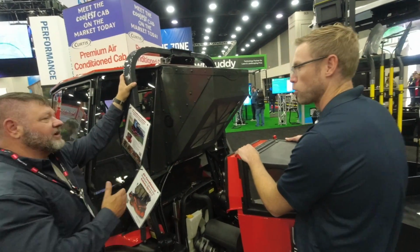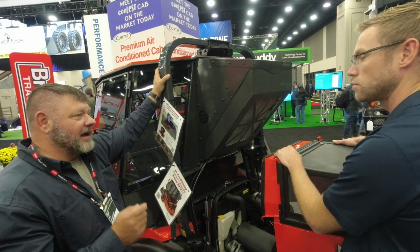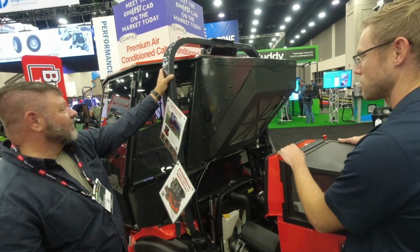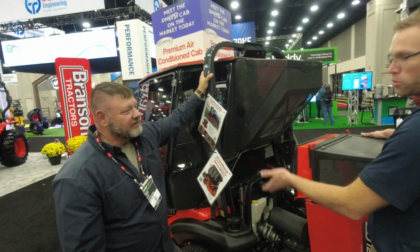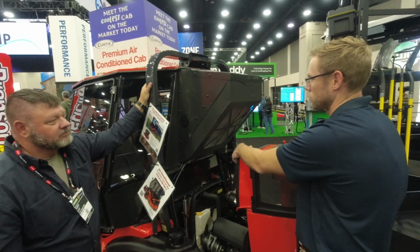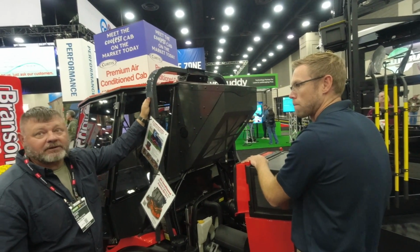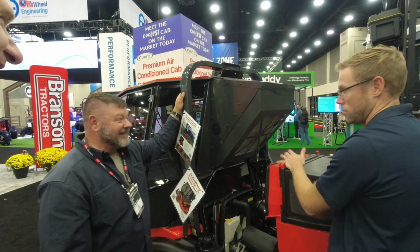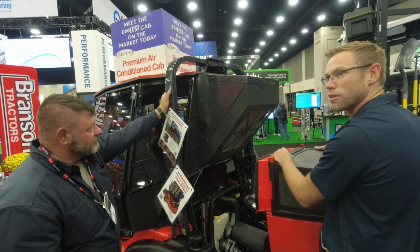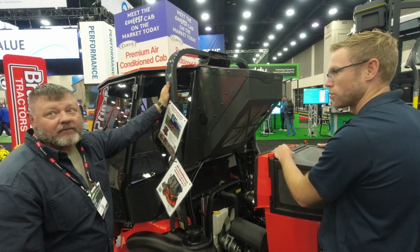So we decided everything's appropriate. Tennessee. It's 100 degrees outside and humidity is 9,000%. Wouldn't it be cool? That's awesome. It is. I'm sold. Well, you figure it's just like a pickup truck. I mean, it's running R134A refrigerant. It's a 1.5 ton system. I got my sunroom, and it doesn't have that much. Yeah, that means pumping air. You can get the same air conditioner put in your sunroom. Yeah, it's really nice. I don't know if my wife will let me have one.